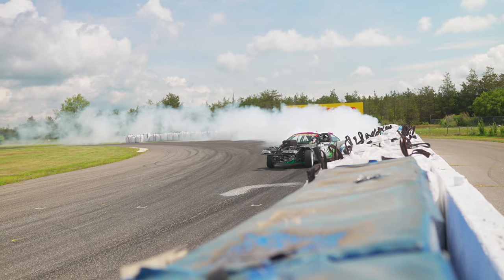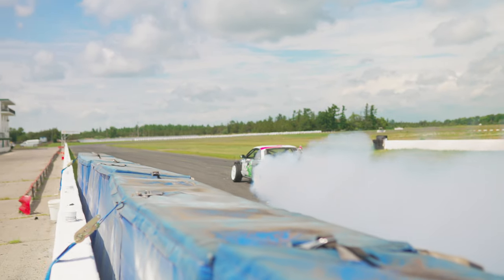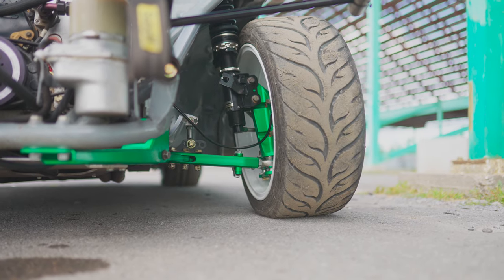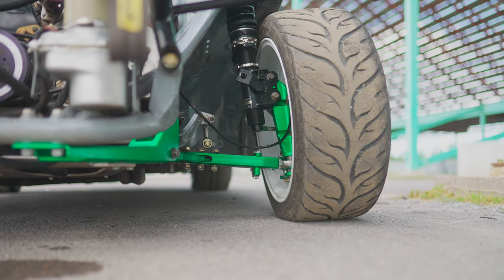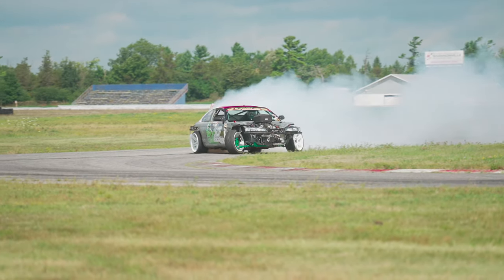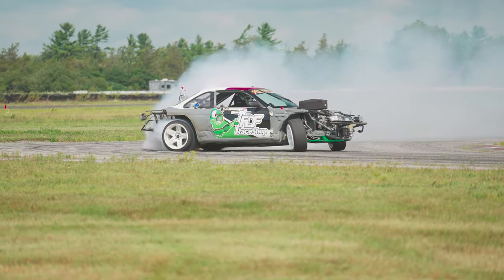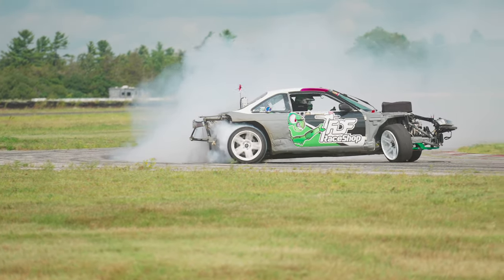I'm not one of those. I prefer a harder, stiff front sway bar. This is going to be great for transferring weight to the rear as well as keeping the front end planted with both tires at their maximum grip potential. Having a front stiff sway bar is something I've always advocated for. I can still have the softer spring rate to handle all the bumps going in a straight line, and then as soon as I get to lock, that sharing spring rate effect comes into play. When I really load up the front corner of my car in drifting, we're running so much grip in the front and rear — I need as much assistance as possible and the heavier bar just feels much, much better. If I was to run the amount of grip that I have with no front bar, the front of my car would be leaning and doing all sorts of crazy things.